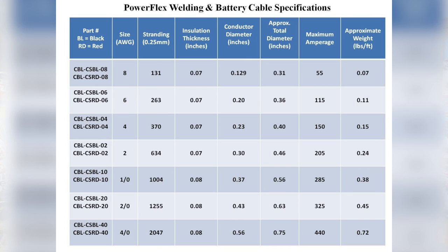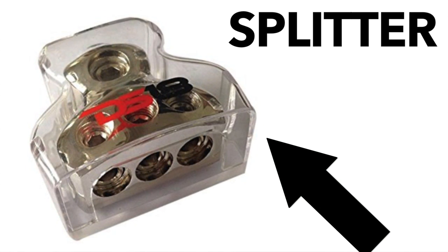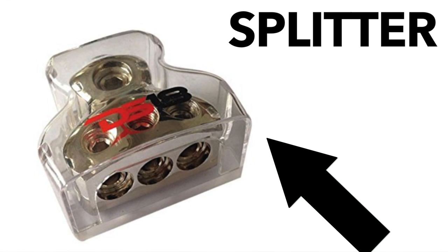I think I used four-gauge wire on that car — same thing on the power side. I ran a four-gauge wire from the battery to a circuit breaker and then up front, directly to the starter. There was a pin on the starter that sent power to the rest of the vehicle. You can get splitters if you want to reduce the size of your wiring — maybe going from four gauge to ten gauge to ground things under the dashboard. I recommend drawing out your wiring diagram on paper first, which will help prevent any weirdness in the planning stage.